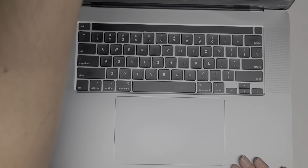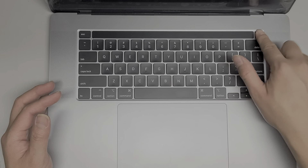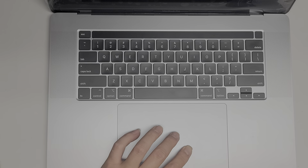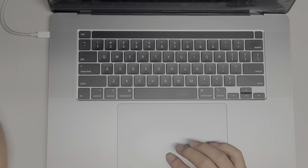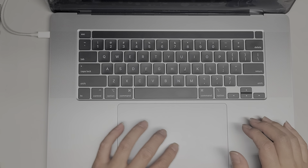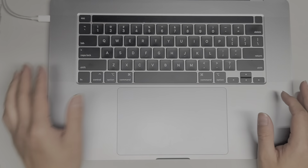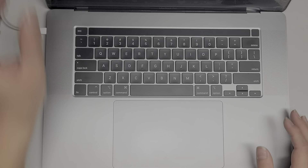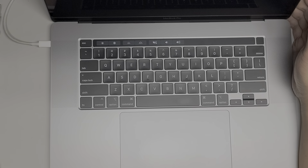So we're going to open this up. Most likely we're going to have to plug it in — you can tell because if you press on the trackpad, it's not clicking. So we're going to go ahead and plug the MacBook in. Plug this in and then see if you can click it. Now the mouse pad is clicking, I can feel it — and that means it should be turning on. You don't actually even have to press the power button. I heard the chime and I see the Apple logo. So it's already better than before — before there was a huge line down the middle and it was all flickering, but now it looks good. We're going to go ahead and peel this screen protector off.